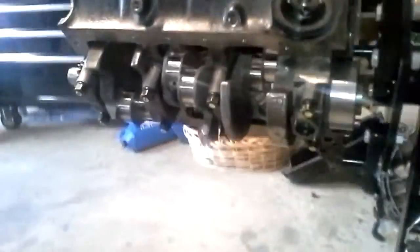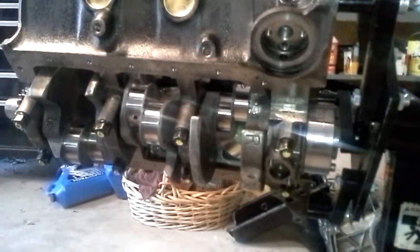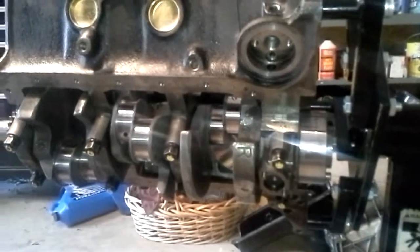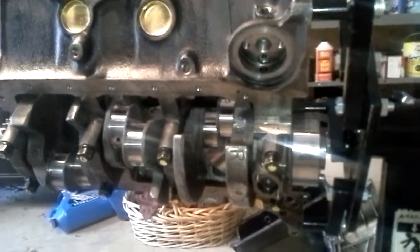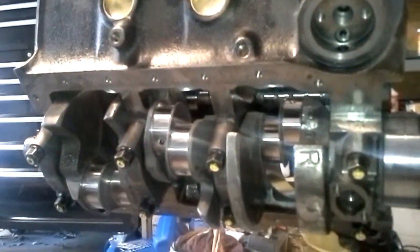Around to this side, just so you can see the crank — final installed. All the clearances for the mains and rods have been set: three thousandths, letter E. Everything has been torqued on the mains, indicated by the yellow paint on the bolt.